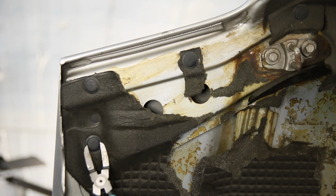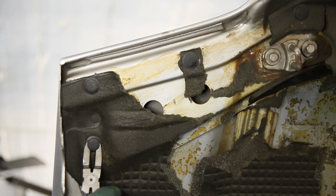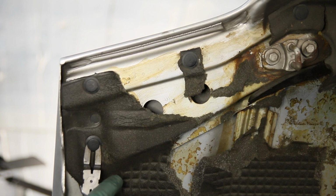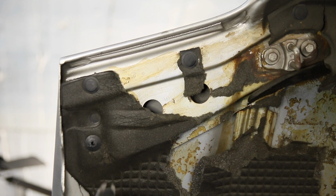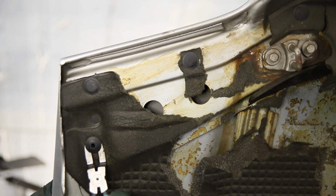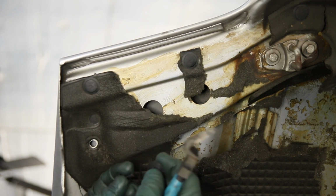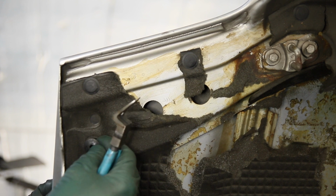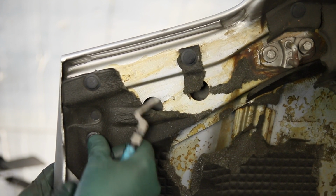Just come in right under the head of the pin and squeeze it a little bit like that. And once you get hold of it, you can just kind of rock this, pinch, rock, pinch, pull the center pin out, and then the plug, just come in under the plug, squeeze, and pull the plug out. You can see how that works. And of course, when you go to put it in, it's just push and then push that in.